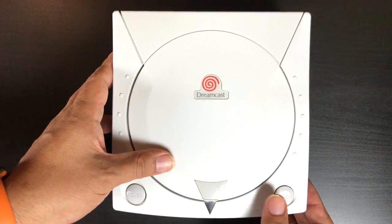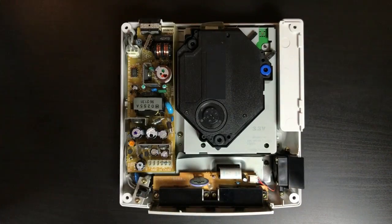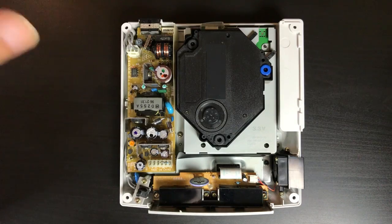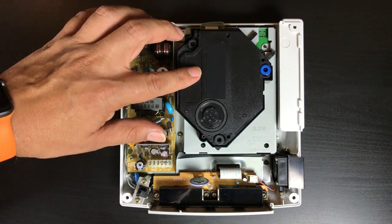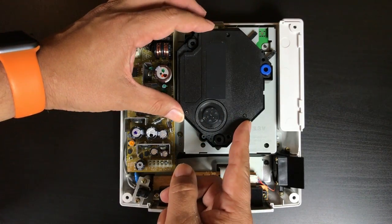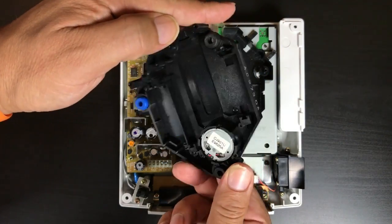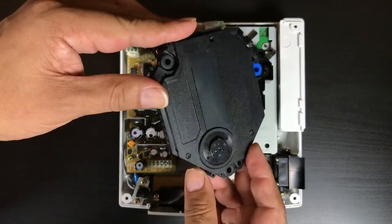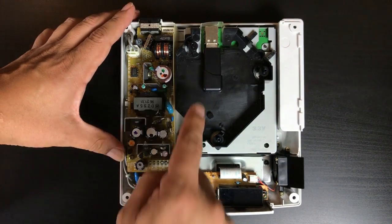So the best solution really is to get rid of the GD-ROM. There's a Russian guy named Nemo and he makes a board that replaces the entire GD-ROM board and lets you use a thumb drive. I kept the housing of the GD-ROM for thermal reasons, which I'll explain in a bit, but there are actually no components in here — it's empty.